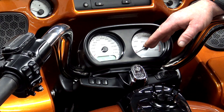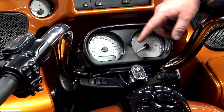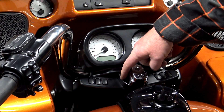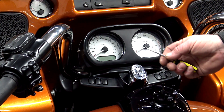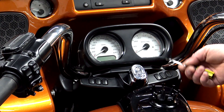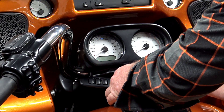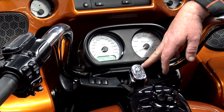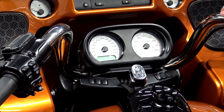To take the gauge cluster off, I've seen guys take the ignition out — there's absolutely no reason to do that. Under there you'll see just a little black shroud with a small piece right in the middle that you can push in with a pick, lift it up, and pull it right out. That hooks on the inside — there's your little clip. Get that out of the way first, then you've got a screw here and a screw here; it's a T25, so remove those.